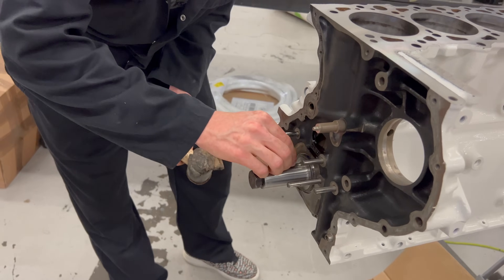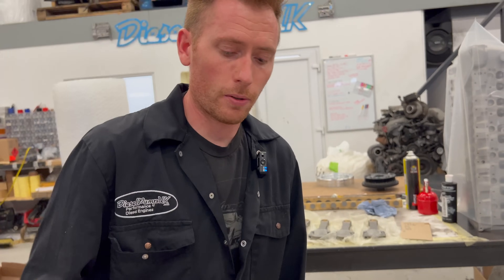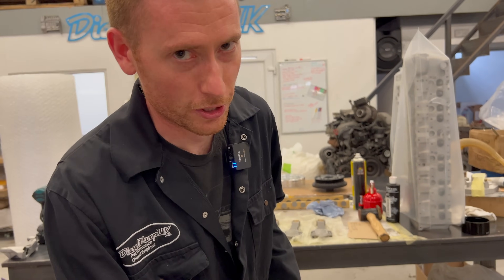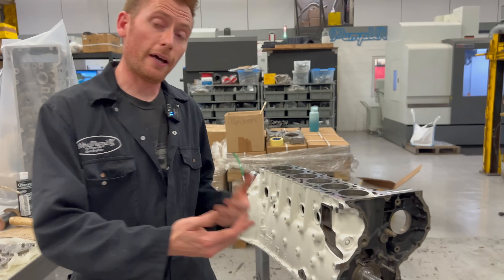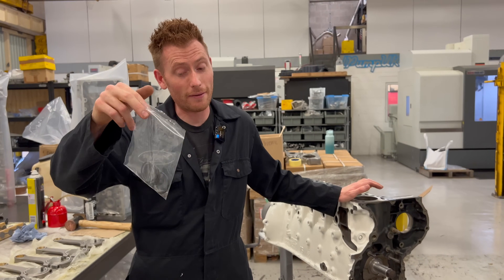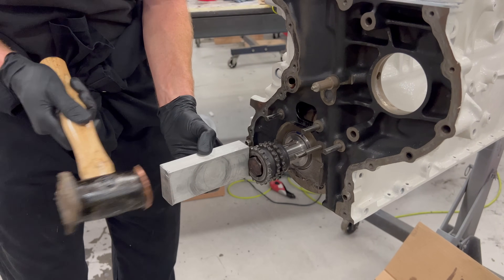For the guys out there that might not have special tools like a copper hammer, you could probably borrow one locally. So pop those two Woodruff keys in, and then simply fit everything as Mercedes intended. After you've done that, drill and do the pinning on the outer. These new keys are much stronger than the original anyway — chances are it'll never spin with these — but putting the dowel in as well is cheap insurance.